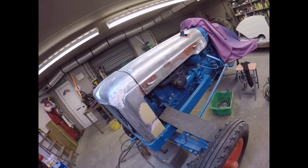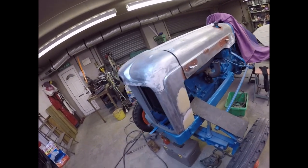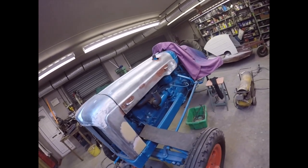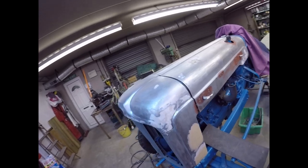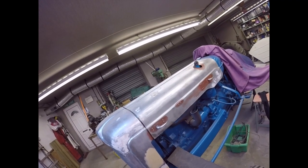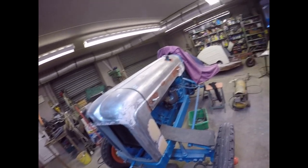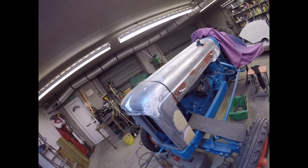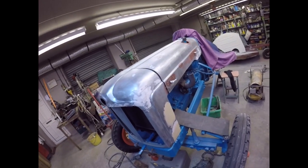If you try to get it perfect with filler, unless you're an expert at filler - which I'm not - you spend hours on it. So I tend to get it roughly right with the filler, belt primer at it, and then when it's dry give it a de-nib with a 180 pad. You can see any little divots in it and all you do is a quick scrape over with stopper and they're gone. That's what I'm going to do with this and it'll look good. I've always believed that reconditioning or rebuilding any piece of machinery mainly involves moving all the dirt and rust from the machine onto me - and that seems to work quite well. See you later, bye now.